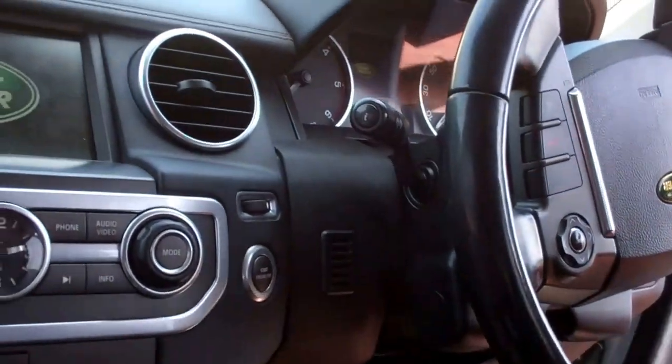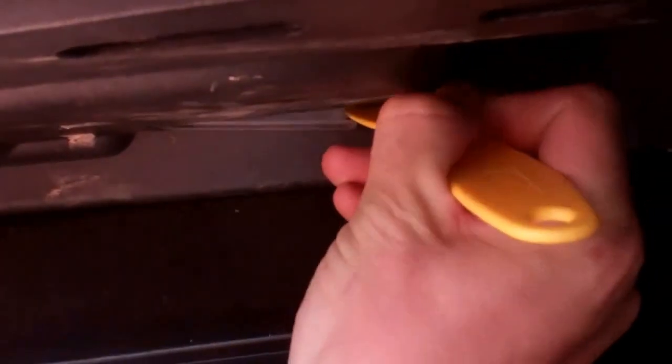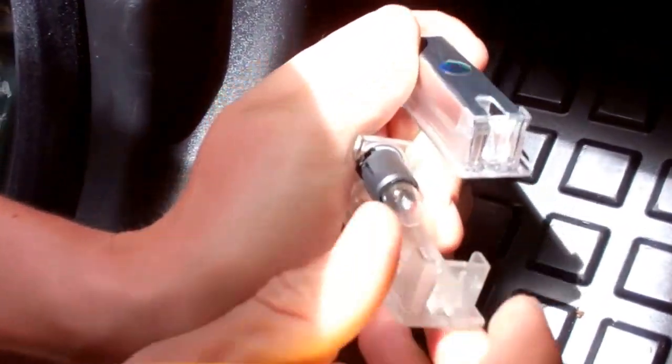For the footwells, I'll grab one — this side's probably easier. The footwell light has a slotted end on it. You may need to pull the panel down and get behind it. The side you need to lever from is towards the center console on both sides, and then they pop out. You press that little spring clip in with the tool to release it.